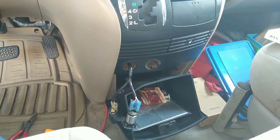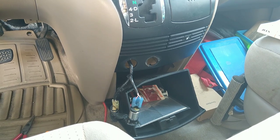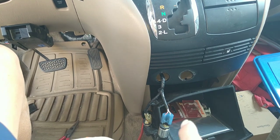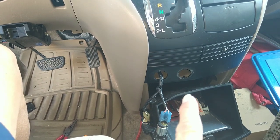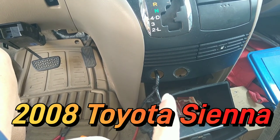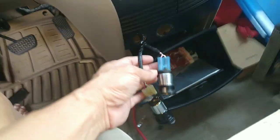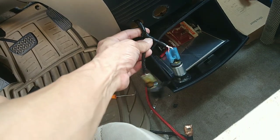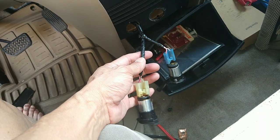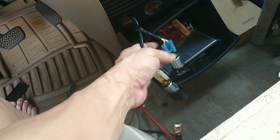Here's a mess that I created for myself instead of checking the easiest part first. Down here there are two outlets — one is called the cigarette lighter and the other one is the power outlet. One is working but the other one is not. As you can see from the cable connections, I thought they were together, but they're not — they are two separate lines of wire.